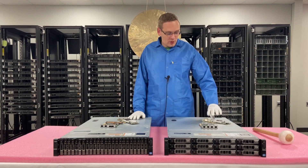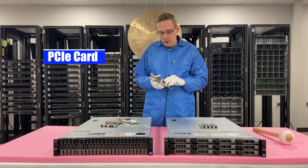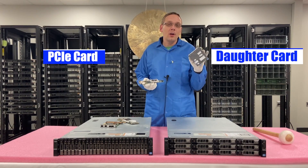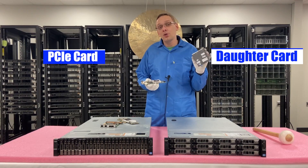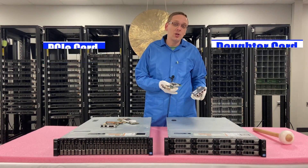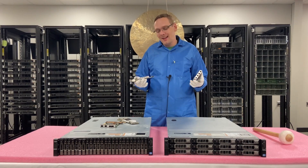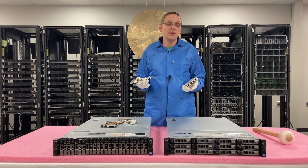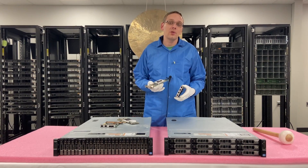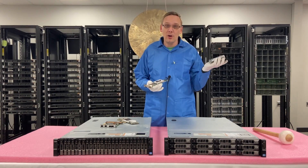The different types you'll notice are a PCIe version that you can install in a PCIe slot, or there is a daughter card. The daughter card is my personal favorite because it has a carved-out section in the board, so you don't have to waste one of your PCIe slots. The R720XD does have six PCIe slots, which is decent, but saving one is important for some use cases. That's why I personally like the daughter card.